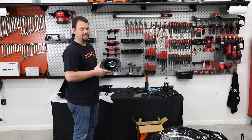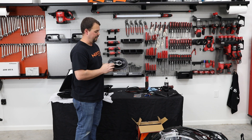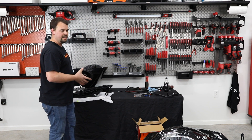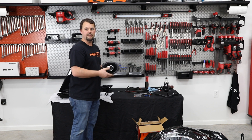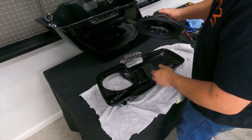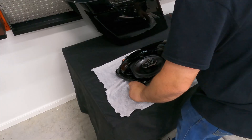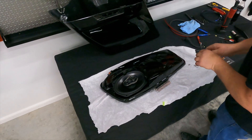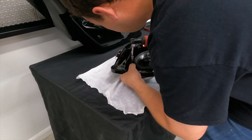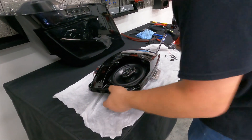It's 260 watts peak, 130 watts RMS. It has a 1.4-inch main tweeter and a 1-inch super tweeter with a 6x9 woofer. We're going to offer this on our website as a kit, both with the Kicker lids and also with some lids from a company called Metro, so we have two different options at two different price points. Let's take this Hertz speaker, fish it through the back side of the lid, keeping our terminals toward the center of the lid for our wiring. We're going to use the supplied hardware from Kicker to mount the speaker.